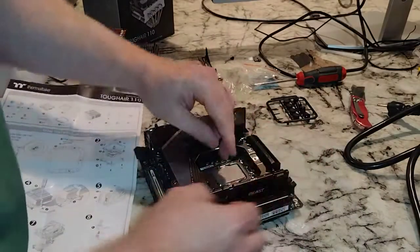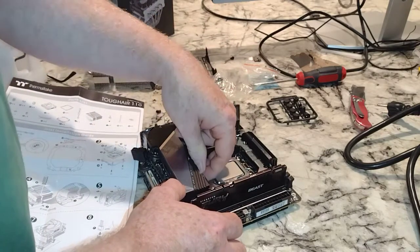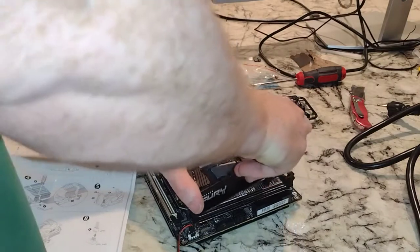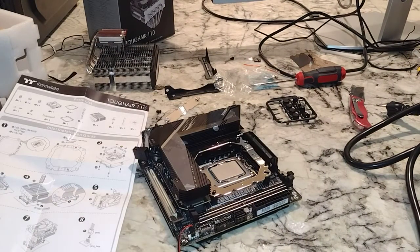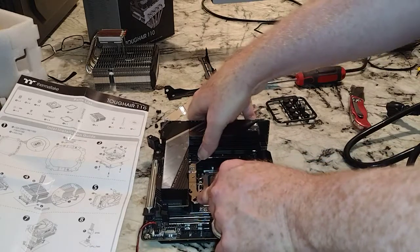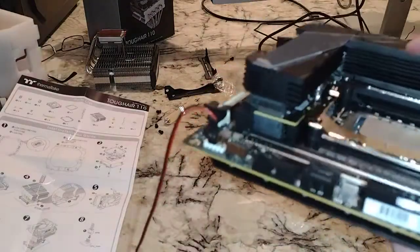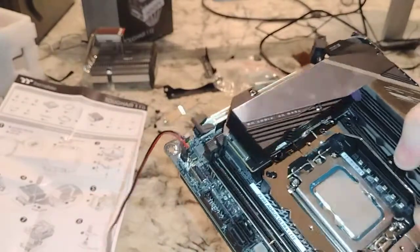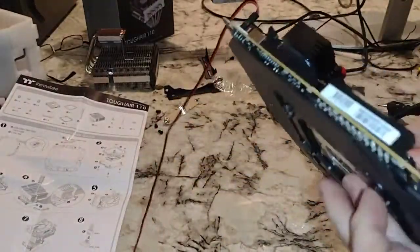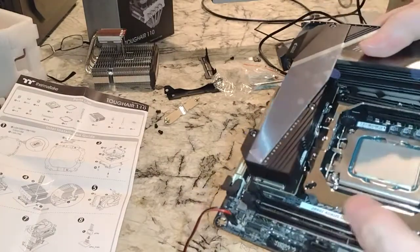This did not work. So this is not compatible. Let me take my RAM out — Kingston Fury 5600 MHz DDR5. I should have taken that out earlier. We're having quite a bit of interference in here. You don't want to force stuff in. It's not wanting to go all the way down — it's catching on our BTB board, which is part of the Z690i.